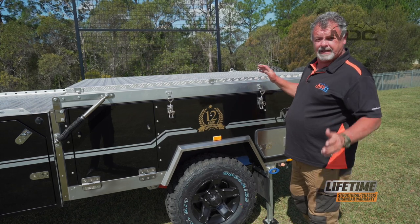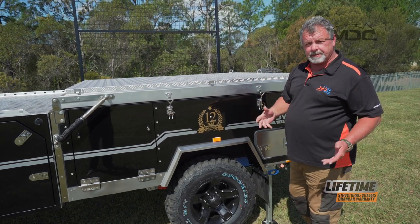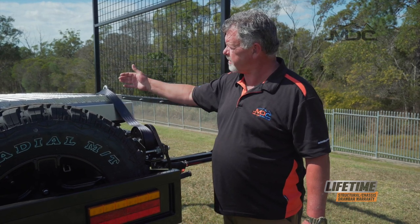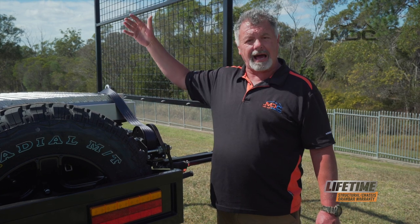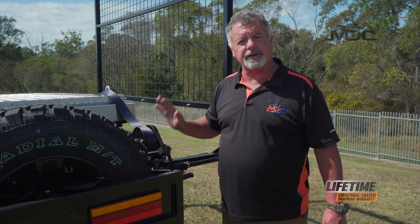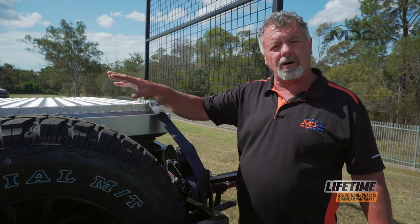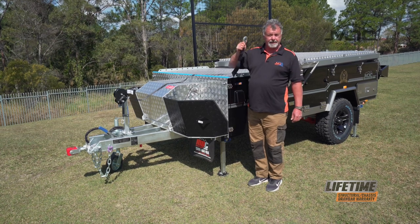So now that's done, it's easy to open. Normally with the Cruiser, the lid is very, very light and two people can quite easily push it over. But I'm going to show you how to do it using the front and rear winch. What I've done is I've unwound the rear winch and let enough of the webbing out that extends across the top of the camper and halfway across the front box. That should give me enough slack so that as I winch the lid open with the front winch, it'll allow it to go just past top dead centre and then I can lower it the rest of the way using the rear winch. So now I've measured out how much slack I need, I can attach the snap hook onto the eyelet on top. Now I'll run the front winch to the centre eyelet and I'm almost ready to start opening the camper.